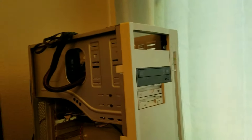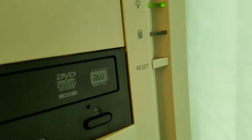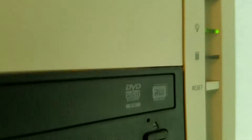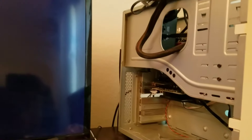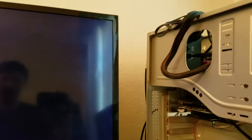Hold the graphics card. Auto-adjusting. Still black, nothing. Hard drive LED is behaving normally. It can't work the first time — why? I just want it to work. I'm pretty sure it's the video card — I'm almost certain that's what it is. The video card just doesn't want to display properly. Maybe it's trying to display through the DVI port and it just can't, obviously, because it's not plugged in. I need to find a DVI cable. Is this it? Yep, this is it — that's what I need.